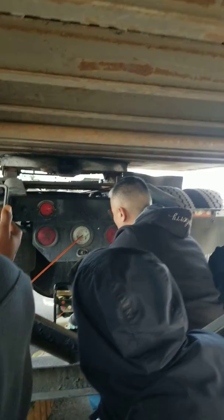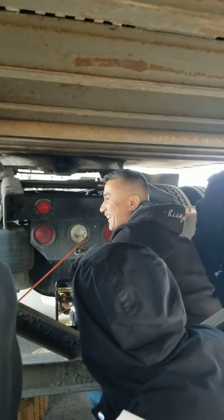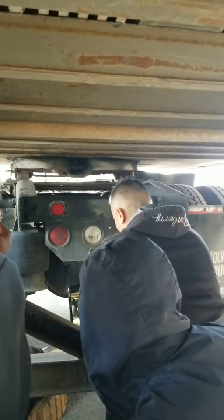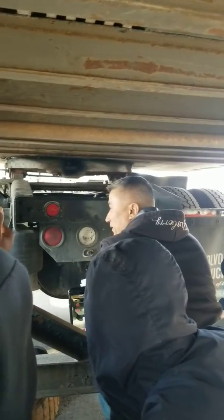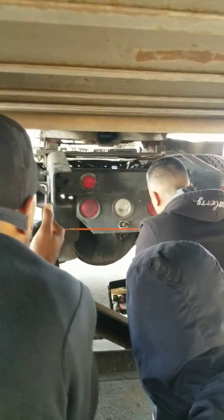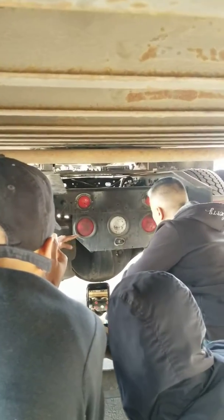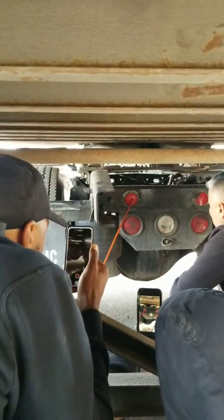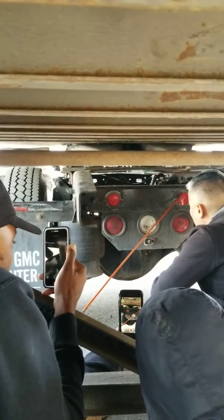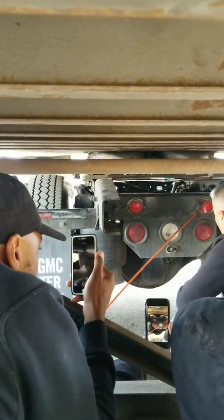Even though this is very dirty, you're going to say it is clean, not cracked or broken, properly attached, and no condensation. Same thing for the front lights — clean, not cracked, properly attached, no condensation. These are called combination lights. On top of the combination lights are two red reflectors — these are not lights, just reflectors, red in color, no missing screws, properly attached, not damaged.